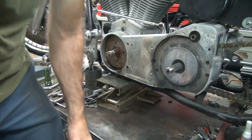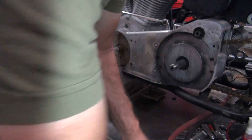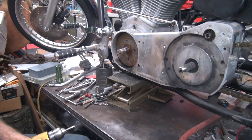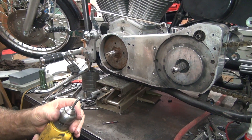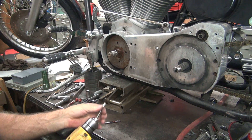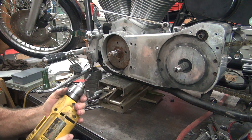All right, let's go over here and see what we can do. Garbage can's in the way, drill motor, tripod's in the way — everything's in the way, that's about normal. So we're going to try to get that thing to come out of there somehow. Now this is carbide — if I go after this it'll just snap and break off. This won't break very easily — it'll break, but it takes more effort, it's not as brittle. If it's going straight it's just going to want to cut the aluminum, so we're going to go at an angle trying to drill into it.